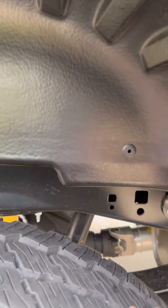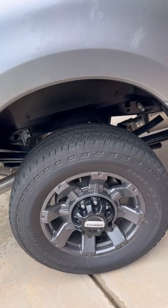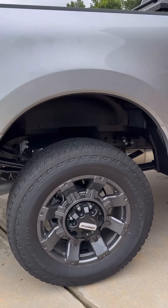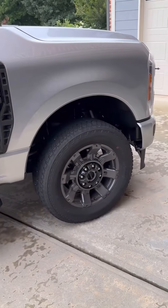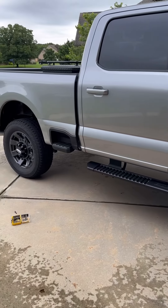I put the visible ones in first, and then the rest I just made work. There you go — I think that looks a lot better than the silver paint. Now we've got the black look and it kind of just matches up with the front. There's the look from front to back, just like that. 2023 Super Duty OEM rear fender liner install — pretty simple, straightforward, good fit. This is probably a 15-minute job. Just make sure you don't confuse your left hand and right hand like I did — I could have sworn it was from the front, but Ford considers these from the back. Anyway, I hope this video was useful and, as always, consider subscribing.